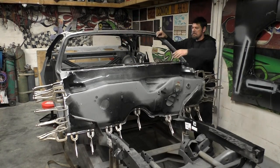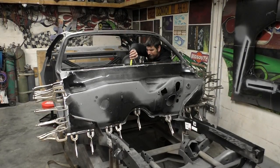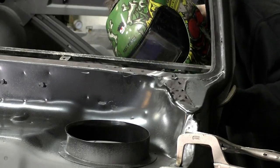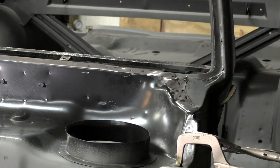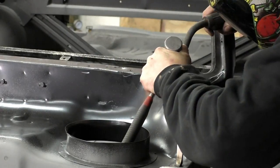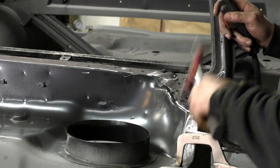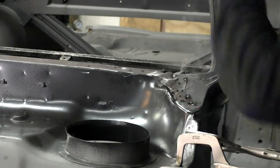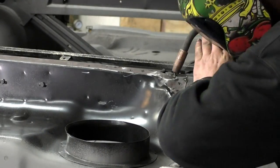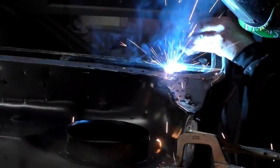Because if we get this wrong, it's going to be harder to adjust the cowl panel since this is the whole base for the cowl panel. Same as clamping — I'm starting on the two brackets in the back that come across to the cowl panel. You can see I did put spot weld holes for rosette welds, and I'm going to use the MIG welder on this upper A-pillar area because my spot welder can't get behind it.